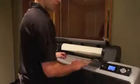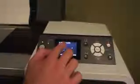Then go to the LCD menu. The upper right-hand button is the platen release. When the light is not lit, it means that the platen is closed. When you press the button, it's going to open. Once the platen is released, you'll see that at the top it's going to say 'paper released.'